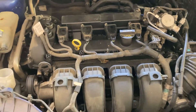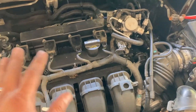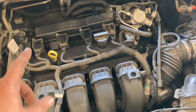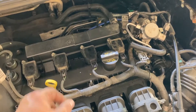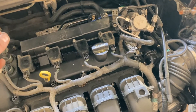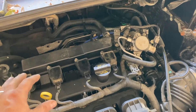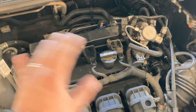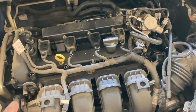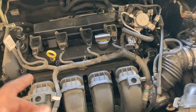The engine's not running completely right. I looked at it a bit and took the coil packs out — they don't look good at all. There's a leak; there's an O-ring around each one that goes down into the spark plug, kind of like a valve cover gasket for the coil pack. All those are leaking, so there's oil down in there. The coil packs themselves are arcing off to the side of the engine, making it run really rough. So we're going to do the valve cover, the valve cover seals around the coil packs, the coil packs themselves.